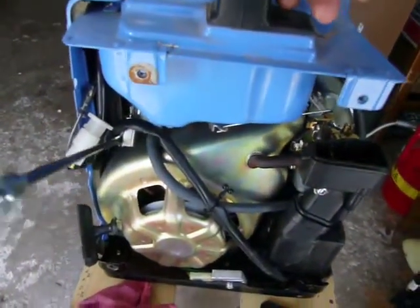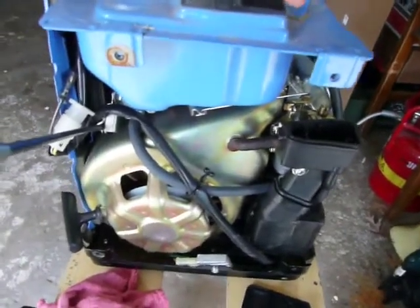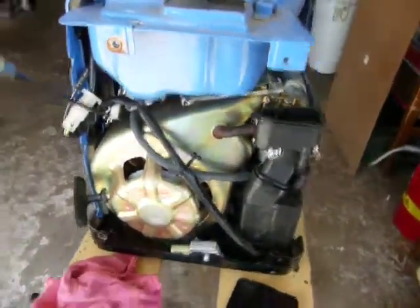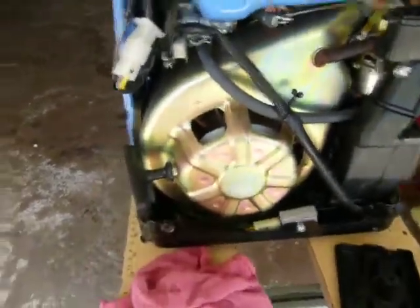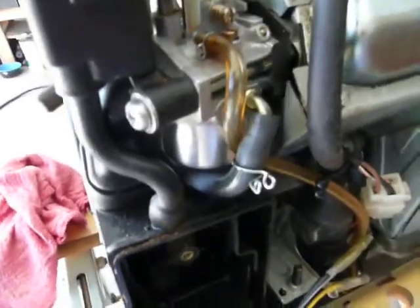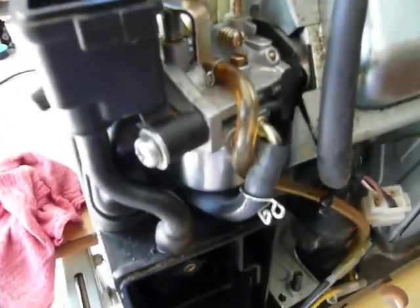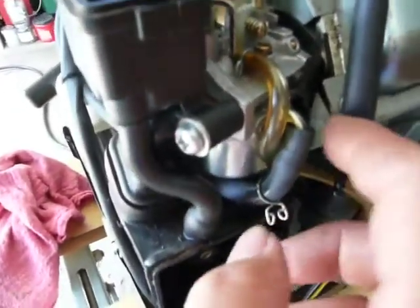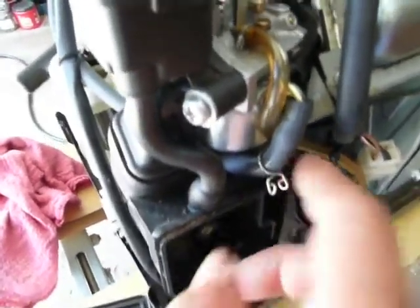Here is the carburetor. When you go to take off the carburetor, I'd say if you have some knowledge about small engines it helps; otherwise, just be careful. Do it step by step and don't miss anything. Remove the fuel line clamps and remove the fuel line from the carburetor. The fuel won't drain because it shuts off at the valve, which is a good thing.